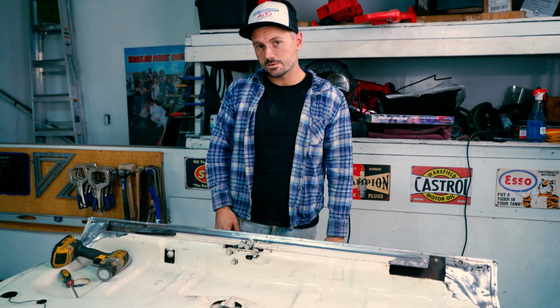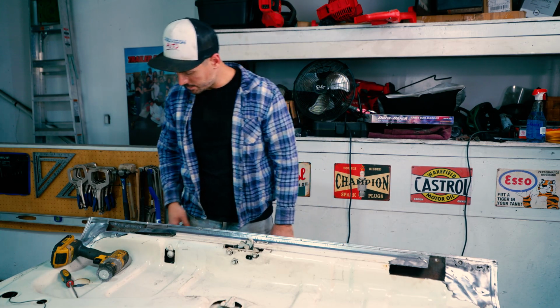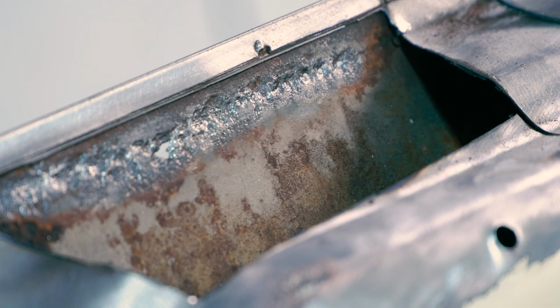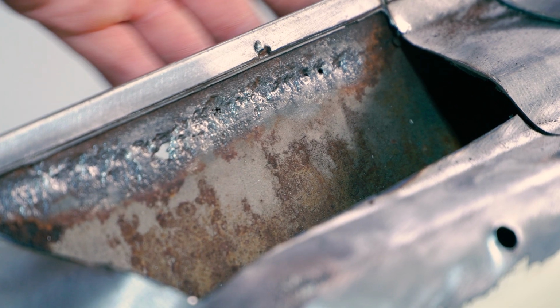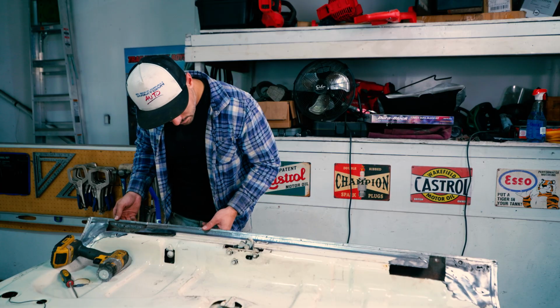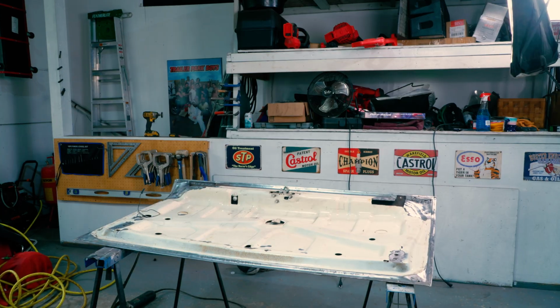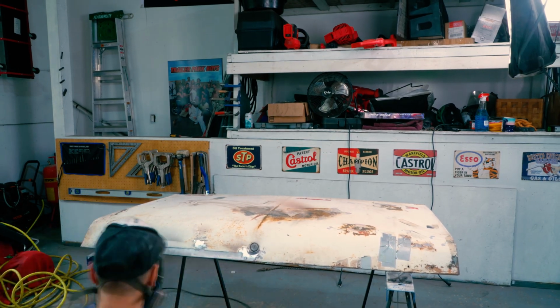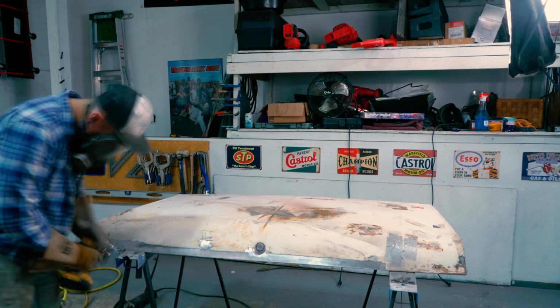When you hear of cars rusting from the inside out, this is what you think of. This is pretty bad. Now, mind you, if you look inside, the rust here is just surface rust. It's not a big deal. If we put that frame coating on, it'd be okay. I didn't expect to have to do anything on the outer skin, so I don't know what to do anymore. I think what I have to do is flip this over and sand along the seam here. If there's a billion holes, it's not worth fixing.